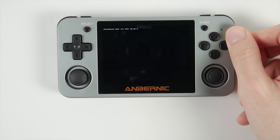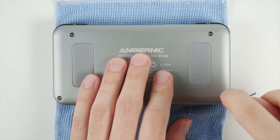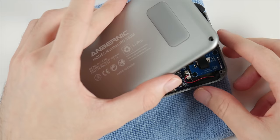Sometimes you can run into graphical glitches when the scaler is set to hardware — that's the main reason I don't bother using the hardware scaler at all. Beyond this, the hardware scaler jumps through multiple different resolutions mid-game if the game happens to support different resolutions. The jumps are jarring, and they are only present when using this new hardware scaling option. Now let's take a look at the inside of the device.